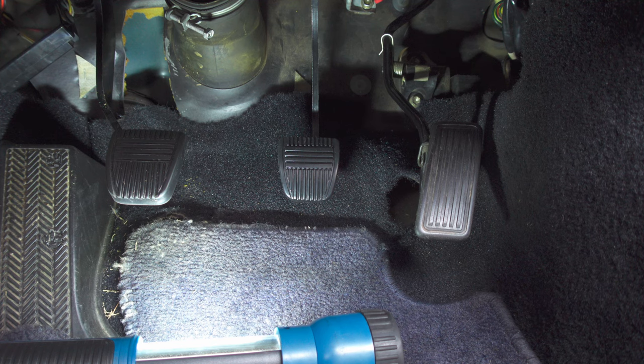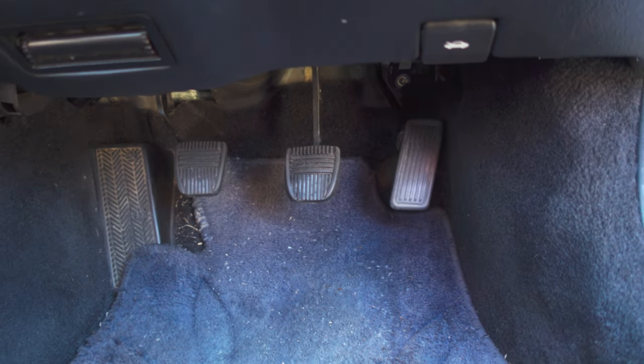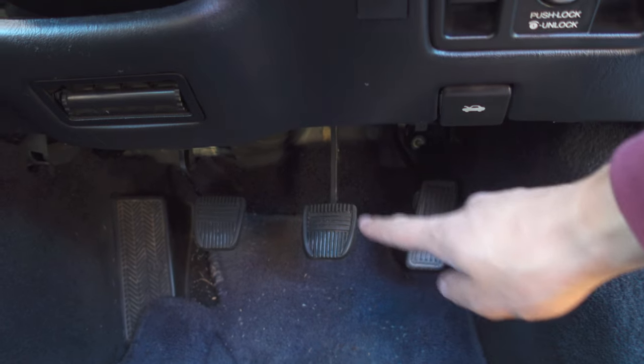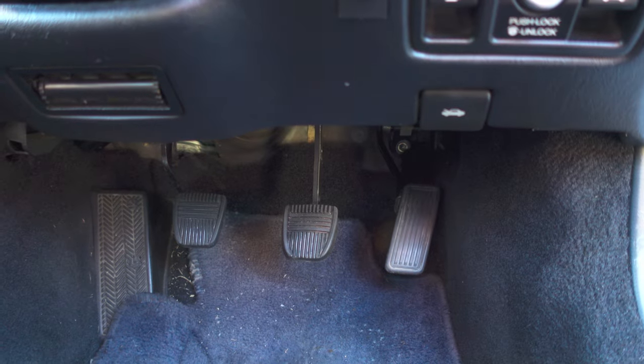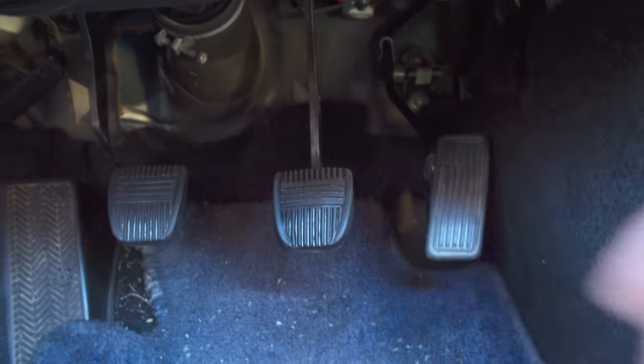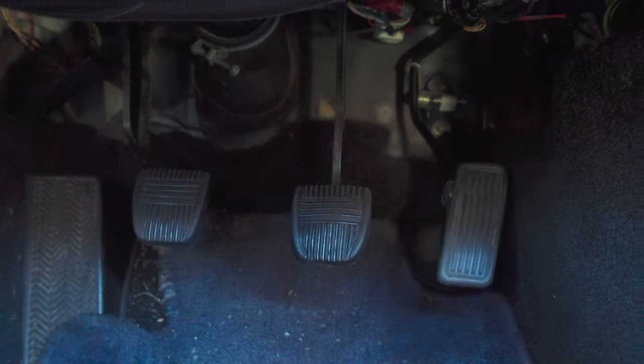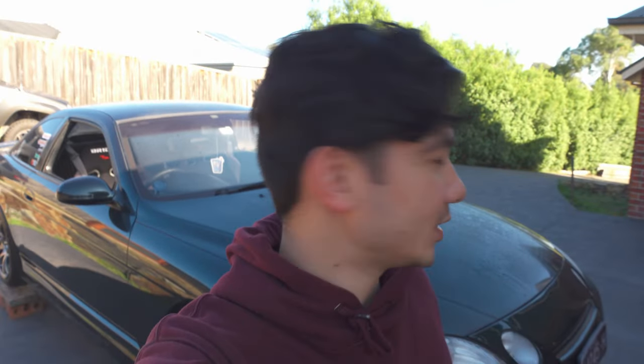It's actually been a couple of weeks and it's a bit of a case of solve one problem and onto the next. But before I get to the actual issue, I want to quickly show you the pedals. Moving into the pedal area - you can see it's now pretty evenly spaced. This pedal here, which is actually an automatic pedal, the steel was actually soft enough I literally just put it in a vise and bent it straight. The only small issue is the height is now a little bit longer, but it's almost not noticeable. Pretty happy with how that went.